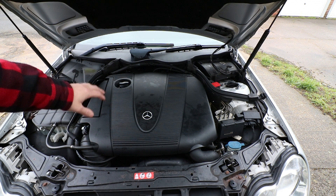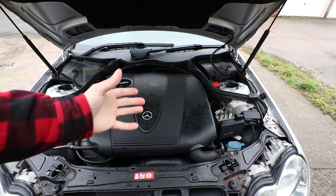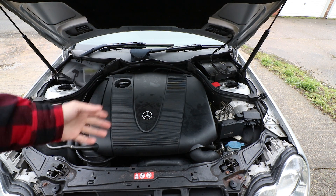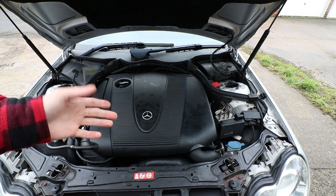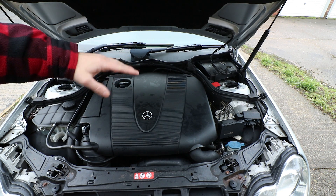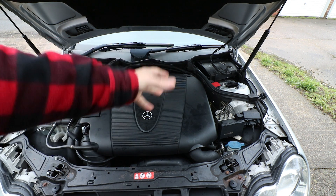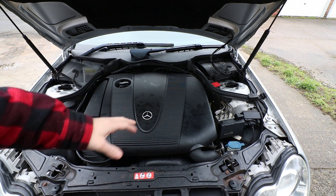About a year ago my fiancée was driving this and she had a black box at the time. It was plugged in via the OBD port and it actually flagged up to the RAC app saying there was an EGR code. Occasionally it'd go into limp mode — it just wouldn't boost properly, the revs would fluctuate, and it'd jerk a bit at 70 on the motorway. So we whipped it out, cleaned it, and it fixed the issue — didn't cost us anything.